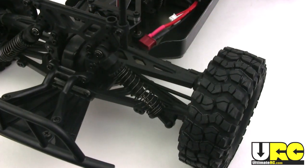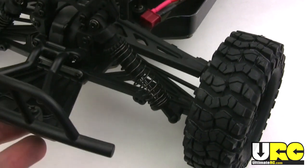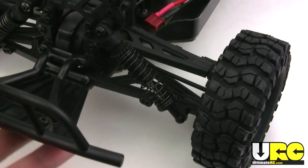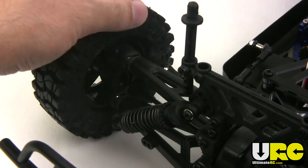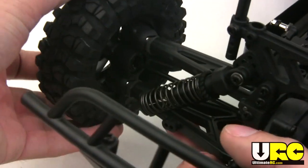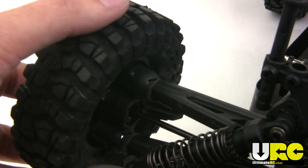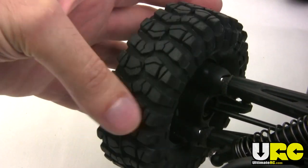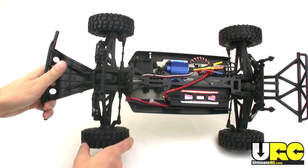Looking at the suspension, it's double wishbone all the way around. However the shocks are really, really, really laid down and it just makes it very lazy. They're laid down far too much and you really need a lot more stiffness compared to what comes right out of the box. At the ends you have pillow balls on all four corners, but there's a lot of slop in the joints in pretty much every direction, and a lot of it cannot be removed by just making adjustments or tightening things up.